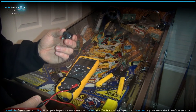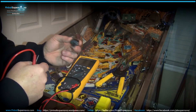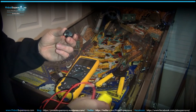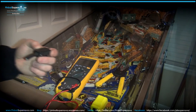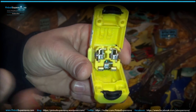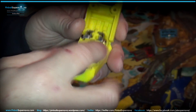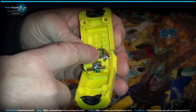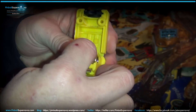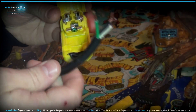You never know, you want to double-check — you don't want to be surprised with your five-thousand-dollar pinball machine because you wired something the wrong way. Now we're going to cut the other wire — the plug side — expose the wires, and connect them into the housing of the new plug end that has the ground on it. Here's the new plug end: there are screws on the sides to loosen so you can put wire through, feed it into the notch, tighten the screw, and the metal squeezes to lock the wire in place.